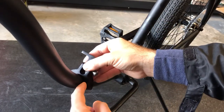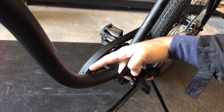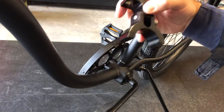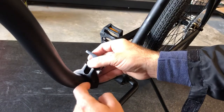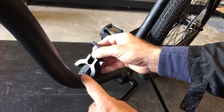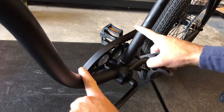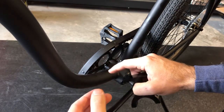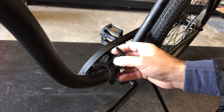Unless you order the 1.25-inch front CNC engine mounts specifically from mbreble.com for $44, you're going to have to create a shim. I really do not recommend using rubber between your frame and the CNC engine mount on either connection, because over time the engine's vibration is going to break down that rubber, it's going to degrade, and then it's going to create a loose connection.